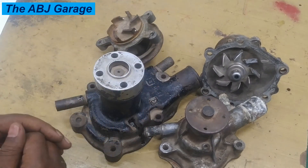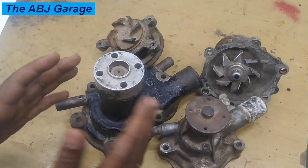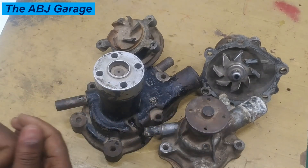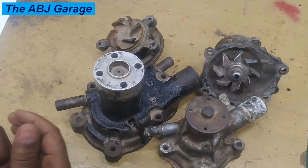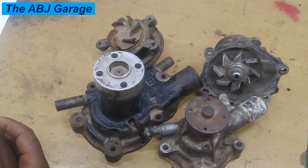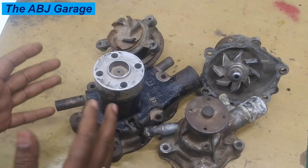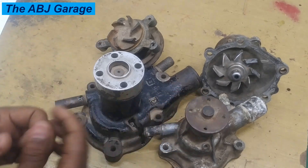And a wobbling pump pulley — if there is a wobbling pulley, that could be an indication of a failing water pump. We have also discussed that fluctuation of engine temperature — if there is frequent gauge fluctuation — that could be an indication of water pump failure. Frequent low coolant level and visible damage or corrosion on the water pump components are also symptoms.